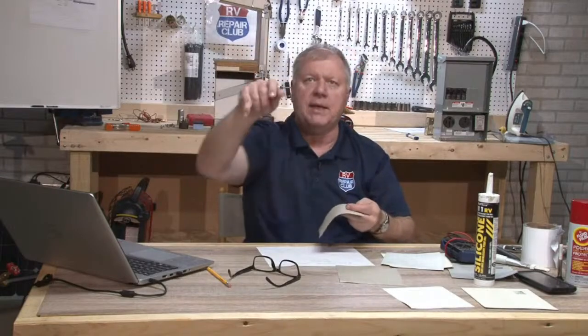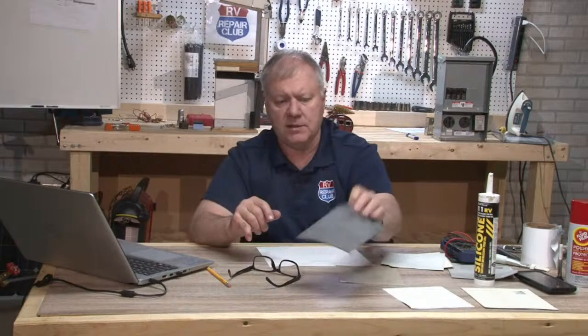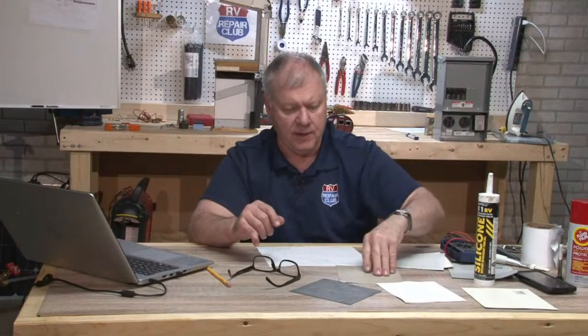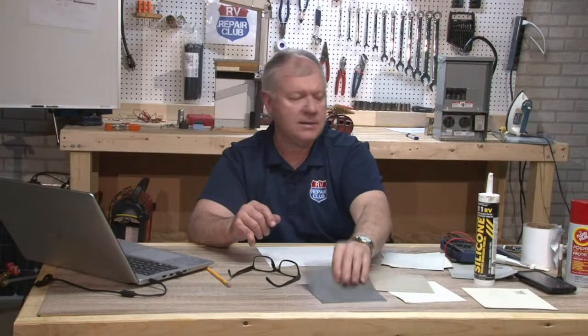They just put a big X and cut the excess out, so you'll be able to see the backside. If it's the same color as the front, then it's the TPO or the Diflex like they have here. Same with this one, but if it's one color here and black on the back, it's EPDM.